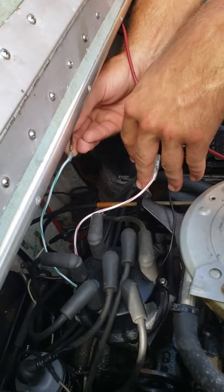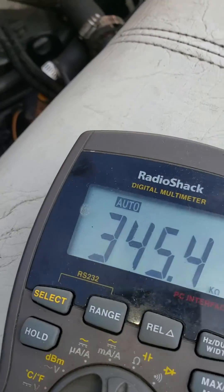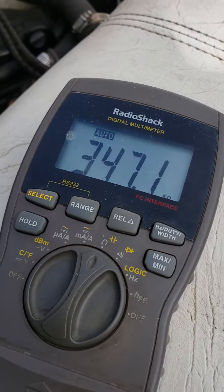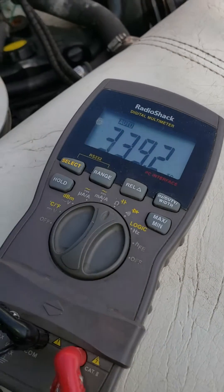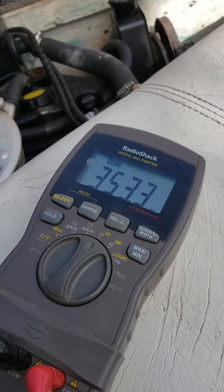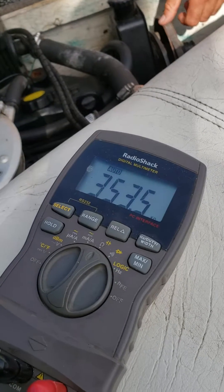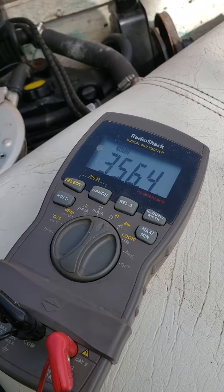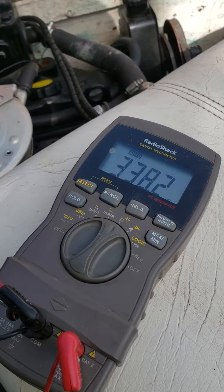Now on the newer part, the green wire, we're reading about 340 kilo ohms. And then we have the black wire going to the chassis ground, so we're just connecting the chassis ground relative to the red and green. It looks like there is a resistance difference between the red and the green, and hopefully that will help you troubleshoot your broken ignition sensor. Thank you.